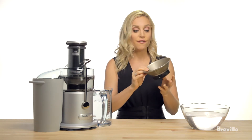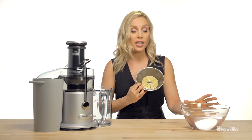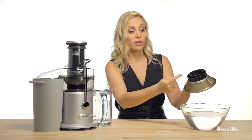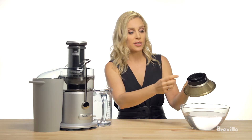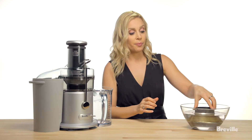If it is clogged, the filter needs to be soaked. Use a solution of half white vinegar, half water, then turn it upside down with the black coupling facing upwards and submerge it into the solution. Let that sit overnight to give it a really good soak.